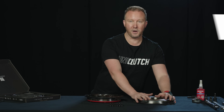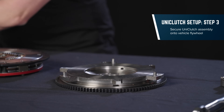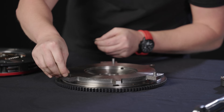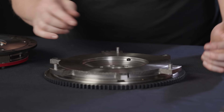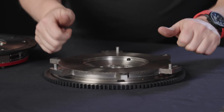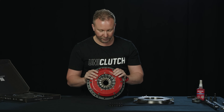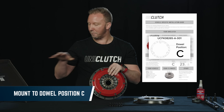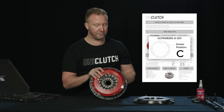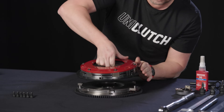Before we put the clutch onto the flywheel, note that the Lotus flywheel here has a small step on it, so we need to put a shim in place so the flywheel mount will sit flat and won't bend over this edge. Most flywheels don't need this — most are normally flat or recessed — but because this has a positive step facing up, we just put those shims on. Now we get our UniClutch Track onto our flywheel using dowel position C. The other positions suit different cars, but position C is what we need for our Lotus, so we just line that up with the factory dowels.